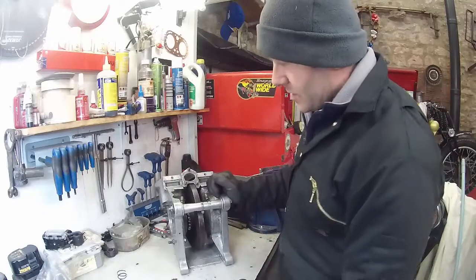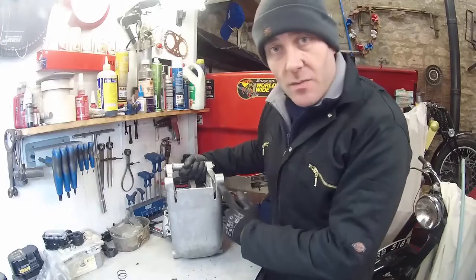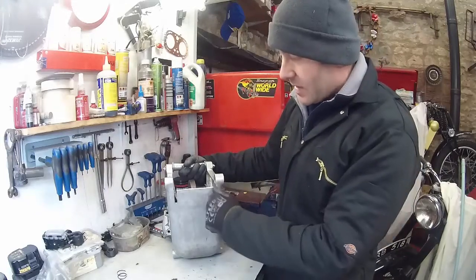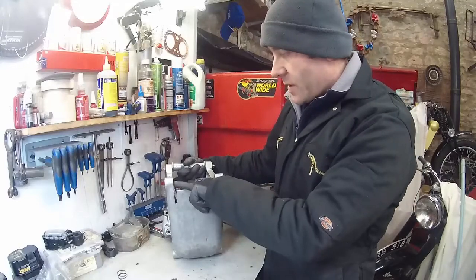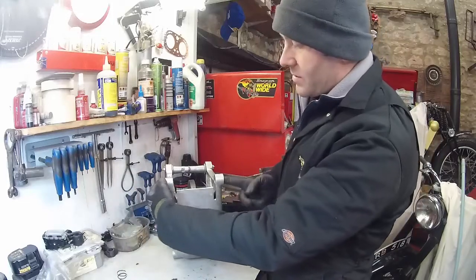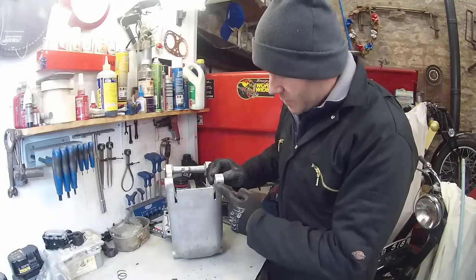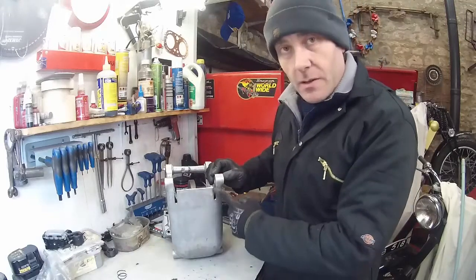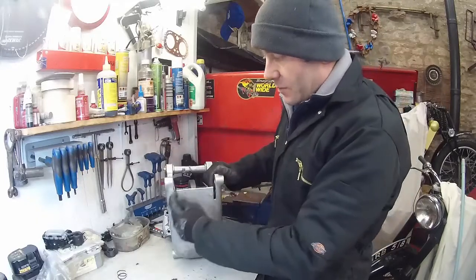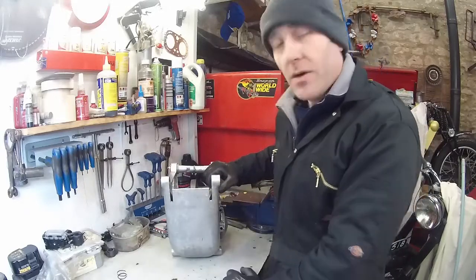The reason I'm putting this one in and not the bottom one is that on this engine I've put some slots in here, which I generally do. Scotts have a square corner there as standard, and what you tend to find is that when the under-tray wears, it wears away this surface on the crank. So owners tighten and tighten the lower bolt that goes through here - it bends these in and it starts to crack from that square corner. So by cutting these relief slots in - these are 8mm wide, 40mm long - it just gives a little bit of movement in those and will prevent your crankcases cracking. It's a common problem on Scotts to find that these bottom lugs have been welded back on again when they've broken.